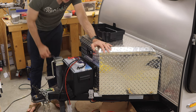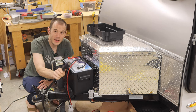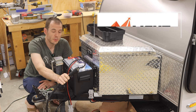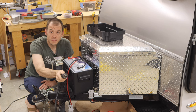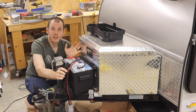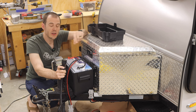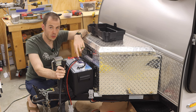We found that the trailer harness was actually pretty worn out and tired, so I went ahead and picked up a brand new wire harness from Nylite — they are a wonderful channel sponsor. I have a few upgrades on the back of the trailer as well. This is one of your standard 7-pin connectors that we have here in North America, and this is what powers essentially all of the lighting on the trailer that is not part of your living space — running lights, taillights, brake lights, turn signals. With some of the electrical setup I'm going to show you in a minute, we also now support alternator charging directly to this battery through a split charge controller.